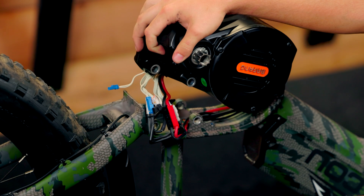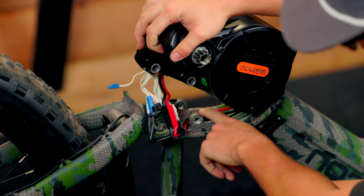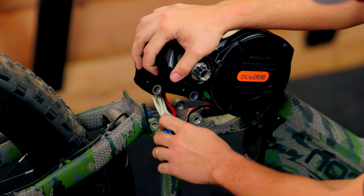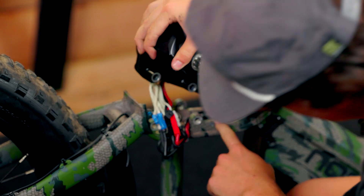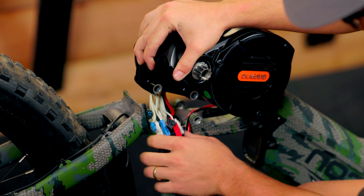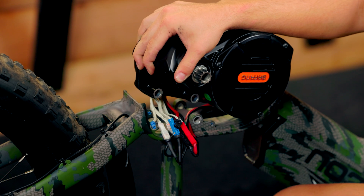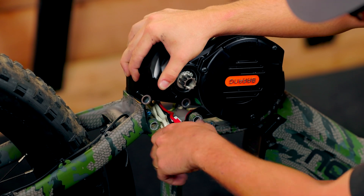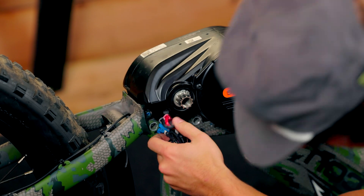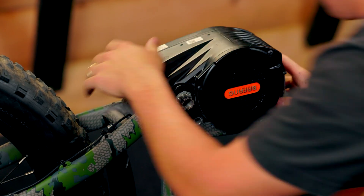I'll get to this position right here where the front of the motor is resting on the frame and the rest of the wiring is back here where I can see all of it. What I'll do is grab it and pull it kind of in a bunch like this, where I can see in here that none of this wiring is going to get crushed by the frame. It's all sitting in the middle and it's all coming out between these last two mounting bracket holes where the mounting bolts go through. Then I'll just set the motor down and check to make sure we have no wires getting crushed.